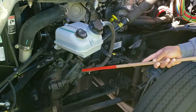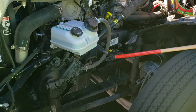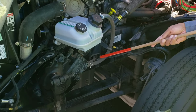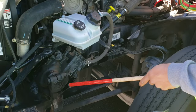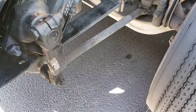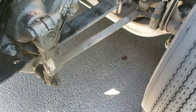Here is my power steering gearbox and hoses — properly mounted and secured on both ends, not cracked, bent, or broken, no abrasions, bulges, or cuts, and they're not leaking. Here is my steering linkage — properly mounted and secured, not cracked, bent, or broken, and not shifted. There are no missing castle nuts or cotter pins.